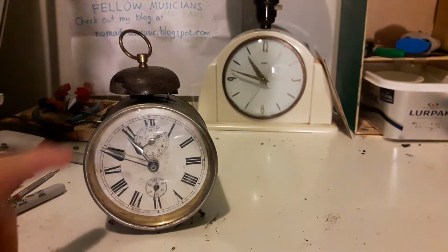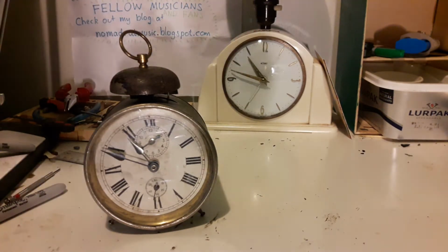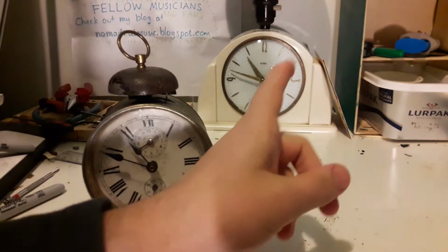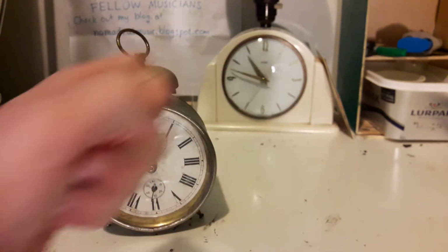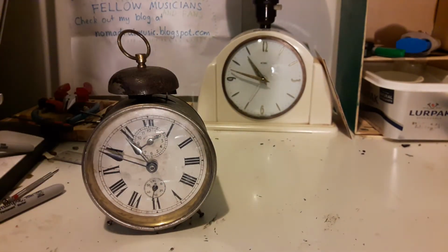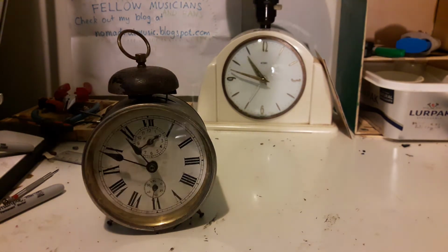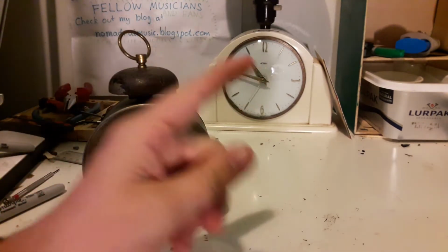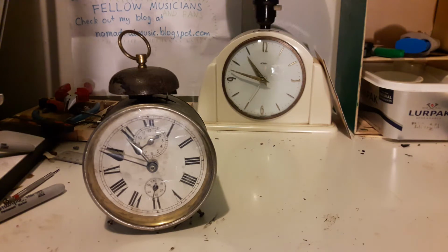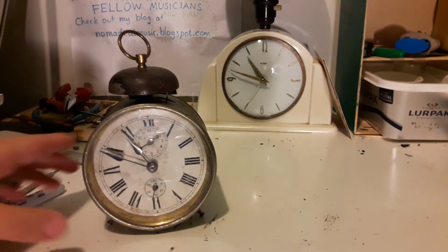And bad news, I'm afraid, this electric Metamec clock in the background decided to stop working. It has done it before, and I think it's down to a little function on the back that if you twist it, it'll tick. I don't know what the purpose of that is, because it's an electric clock and doesn't need to tick. But I think that's probably jamming up the rotor a little bit. I'm not going to do that on camera, but hopefully by the next video I'll get that sorted out.